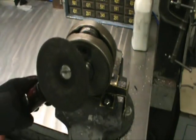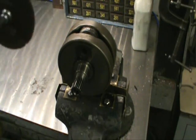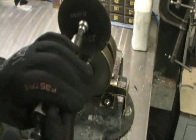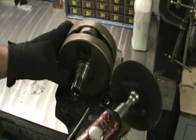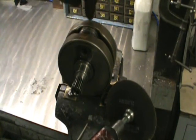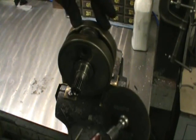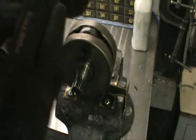This is a pneumatic die grinder with a really big wheel on it. Thinking about things a different way — I'm going to cut this connecting rod right down to this pin, then make this crankshaft two pieces. At that point, I'm down to virgin steel on the inside, hard material, not sheet metal, and I'll be able to push the pins out without damaging my tin cans. This is how we do it.